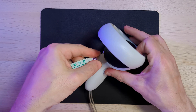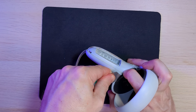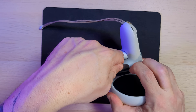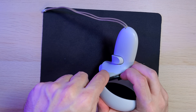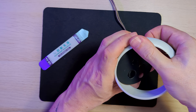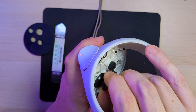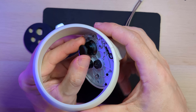You don't want to lift and lever it off because you don't want to break anything - you want to lift it upwards rather than lever it off, because if you're levering it off you might end up snapping parts on the other side. So when that first part has popped open, get a finger into the gap and just lift it slightly, move your separator tool over into the next bit, give a bit more of a wiggle and it'll lift away. Move your finger across, lift a bit more, and gradually work your way around to one side until one connector pops, and then in the other direction towards the other side to pop that one off. Once all three are unclipped, that control overlay will just lift off and expose the buttons and the thumbstick underneath.